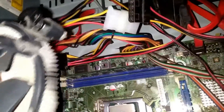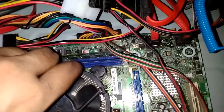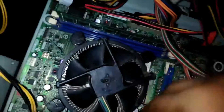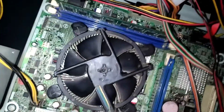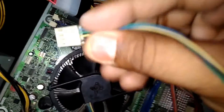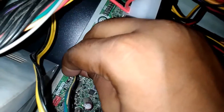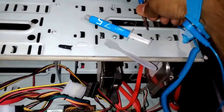Now we're going to clip the fan on. It's really easy — we just need to do everything we did in reverse. We're going to put the fan on, align it, click back the screws, push it in, and then screw them down. The fan should not be wobbly at all — if it wobbles, you need to take it off and reapply, because wobbling means there will be a gap between the CPU cooler and the CPU, which increases temperature. Now we'll reconnect the CPU fan connector. Checking if it's wobbly — it's not, it's sturdy, which is really good. Now you can remove the anti-static band.